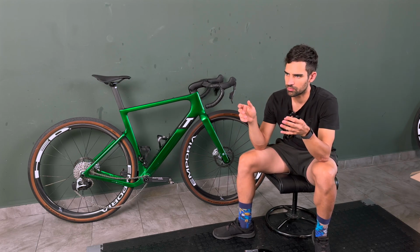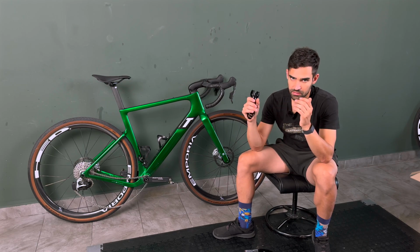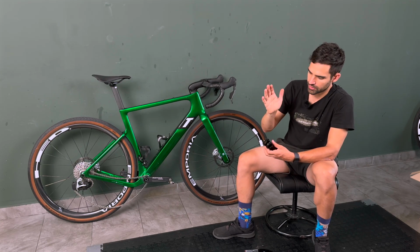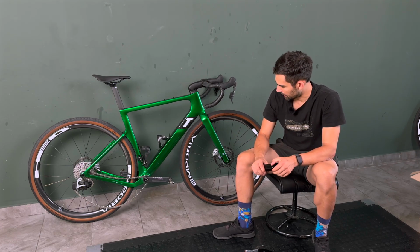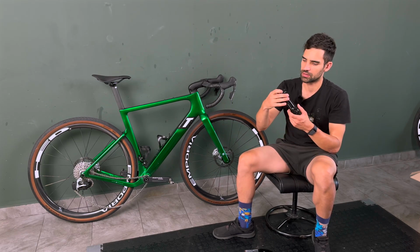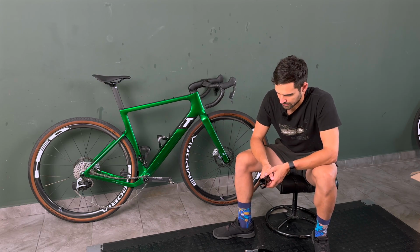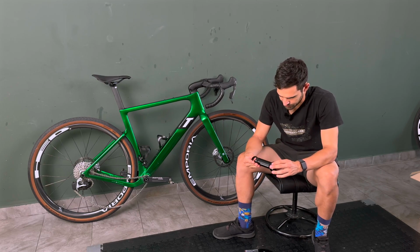As soon as I hit a bump, which you do on gravel, for road it might have been fine, I started to get handlebar slip after a few rides. This is probably also because the Aerocoach bar has quite a long reach, so you get increased leverage compared to the stem clamp. And because of the D-shaped section and the very minimalist steer clamp, it was also possible, if you apply enough force, to twist the bar sideways. So really not a safe combination.